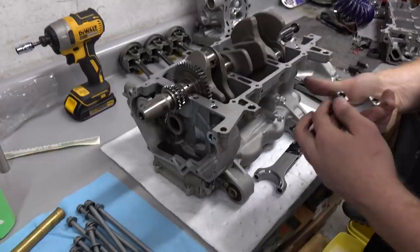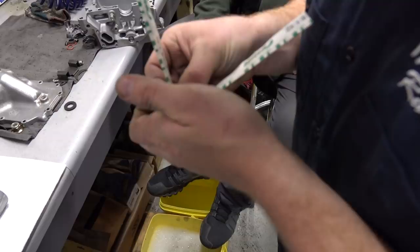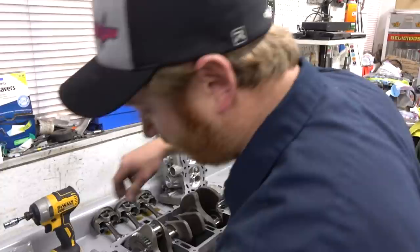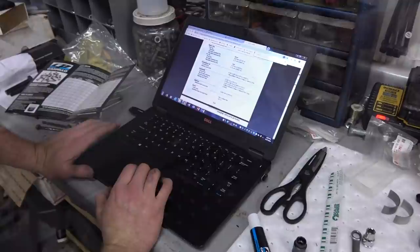We'll see what she says. What does it look like? Let's take a look. Yeah, I agree. It's pretty wide, but I don't think it's too wide, though. Not a bad thing. It looks like we're right at 1.5 thou. So that's about as much as the crank. That's really not bad. It's a little tighter on the big end of the rod. Depending on what the old service manual says, we can get that figured out. It's probably just fine.